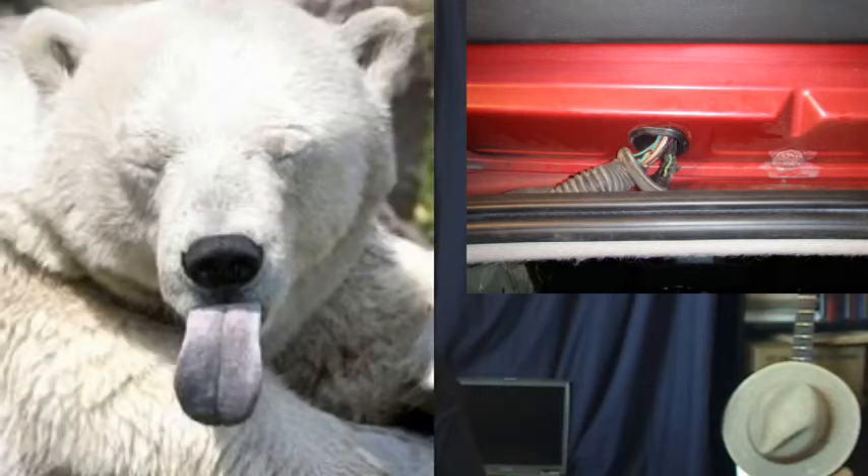As you can see, the wires are frayed. Some wires are frayed, there's chafing on the outer layer of the wire, and the wires are basically bare. This picture shows all of the bare wires — I opened that up and said, oh my God, now I know what the problem was. This could have been pretty dangerous because your brake light is continuously on when certain wires are touching. There is a broken wire, and that broken wire was, in fact, the back hatch wire.